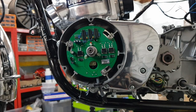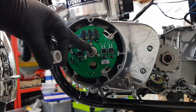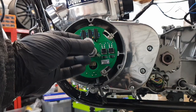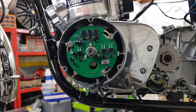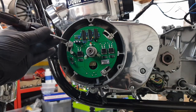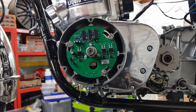In the kit you get a new cam. Take this 14mm nut off, slide the old one out, replace with the new one. You've got a recess there which lines up with a pin so it can't spin. Put that on and tighten it up. Use the allen bolts that you get with the kit. Don't forget to put the washers on, because if you've extended these holes — which you should do before you put it on — that washer obviously helps to earth it.